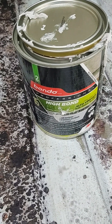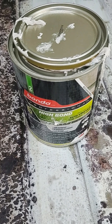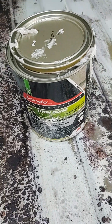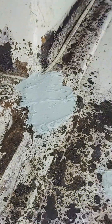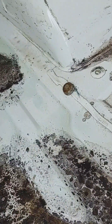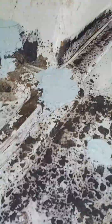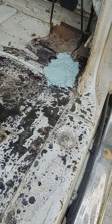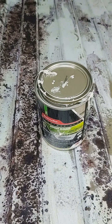This is the Bondo I used — you can get it at Home Depot. This stuff is no joke. I did not film while mixing because once you mix it, it is the quickest setup available — they are not joking. I found lots of little holes and covered them up. I did leave some because I plan on sinking something over the wheel wells. It says you can sand in 30 minutes, but I think we'll let it sit. First time I've used it — use protective gloves. I'm so happy I did; that stuff is nasty.